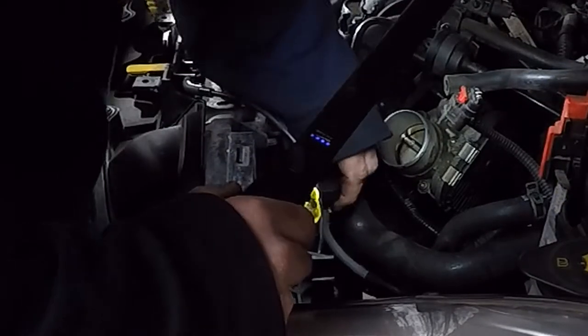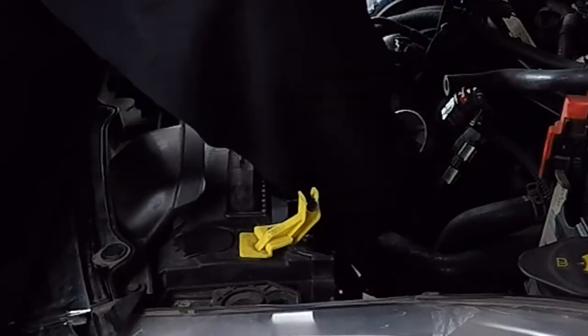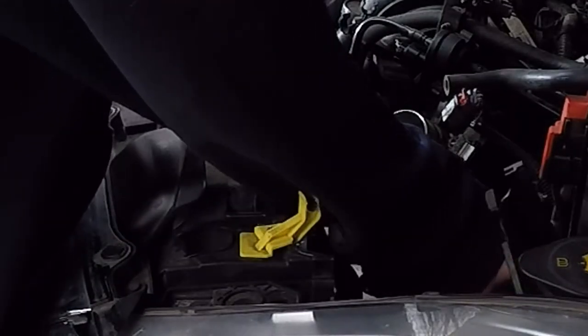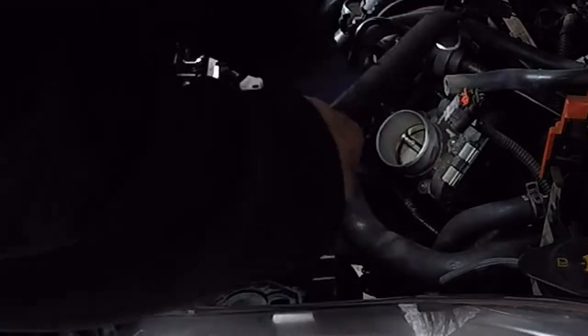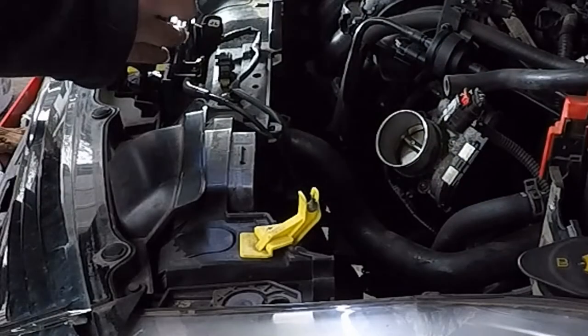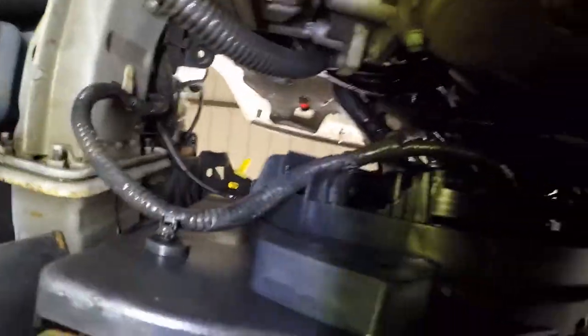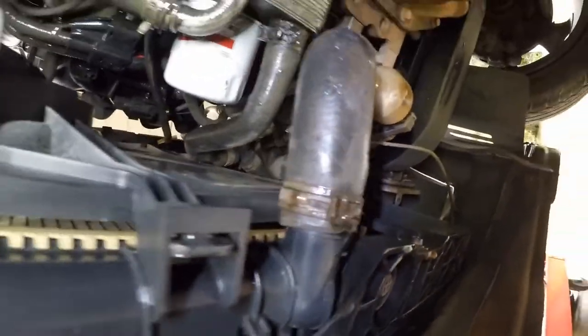You've got some room back here and you've got your thing for your transmission vent. Just kind of pull it off. You've got a vent for your transmission — just push that out and pull it out of the way. This thing don't have a drain, so you'll have to drain it from the bottom, just under your bottom hose. Now while I'm underneath here, I'm going to show you — get all your clips out of your fan right there and unplug it while you're under here. You're going to have to undo this condenser. You've got two clips right here. You can pull your fan out from the bottom. We're going to take this hose off first real quick and drain it that way.